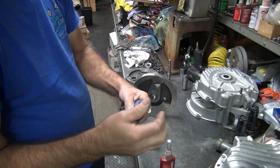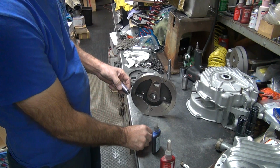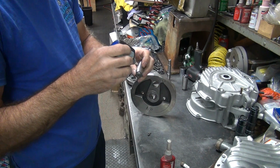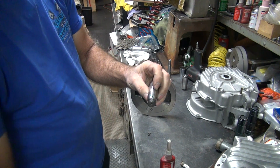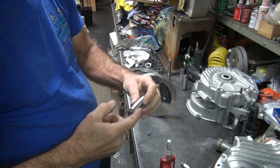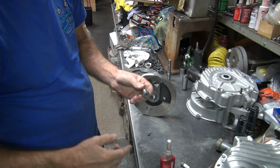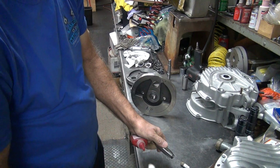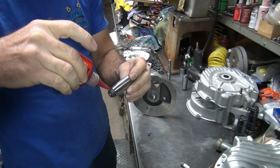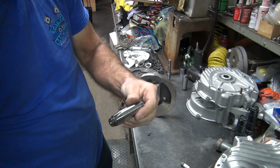Okay, we're going to put a little sleeve retainer on the taper. So the key just slips around there. Yep. Okay, just put a little bit on there like that. Doesn't take a lot to do what we need to do, just a little bit. Wipe off whatever's left over on the thread. Then we take red and put on the thread. Put a fairly liberal amount onto it.